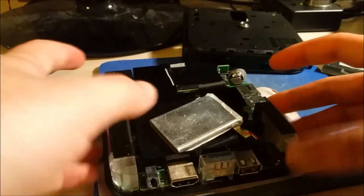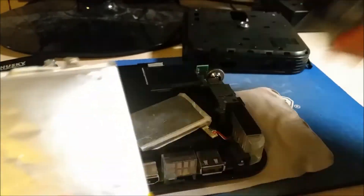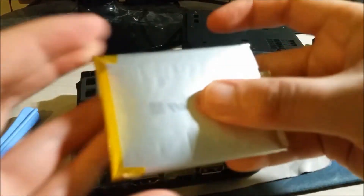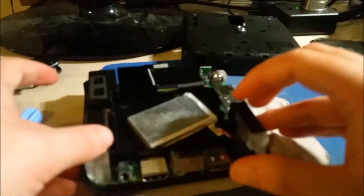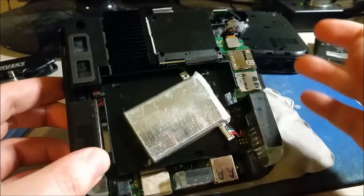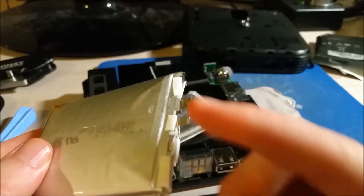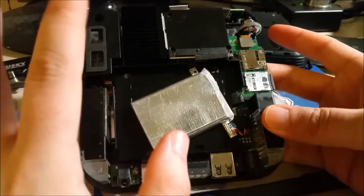So my quest to fix this: I removed the external cover from the original battery and both cells are swollen to all heck. These are just gonna be properly recycled and disposed of — I'm not trusting these at all. They're pillows, not batteries anymore. So instead I took a battery from an original PSP — ironically, from a PSP battery mod I did previously — and soldered it onto the battery charge controller and protection board from the original pack. These cells were just in parallel, so I snipped the wires off and soldered on the much smaller battery.